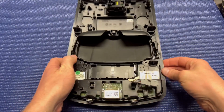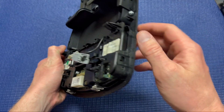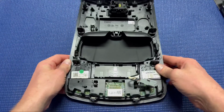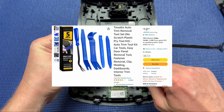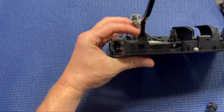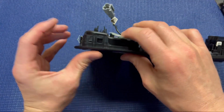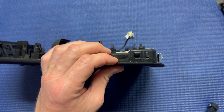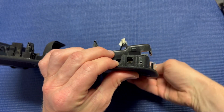Now we have 2 more little pins that are holding this motherboard bracket, I guess you could call it, in place. There's 1 on each side. I'm going to bust out the Trisvolto pry tool again. This comes with the kit. I'll put a link in the description. But you can just use a flathead screwdriver, but this just works so nice. So I just put that in. Gave it a little bit of a pry, and just do it slow. You don't want to break anything, and that whole little bracket should just come free from the unit, and that will give us access to the motherboard.